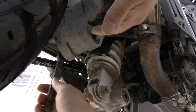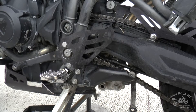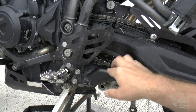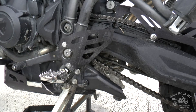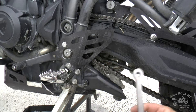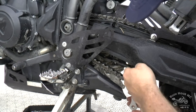Now this one should be easy. I took this one last as it's kind of stuck behind that chain thingy. So what I did was removing this screw, loosening this a bit, and then I could just push this down — I should be able to pull this out. So with the old dog bone off, I'll put on the new one and start in the upper hole. Easy peasy.